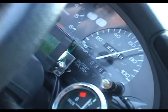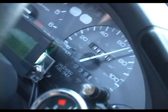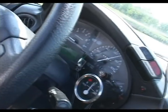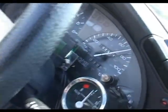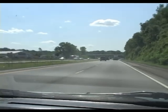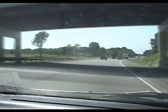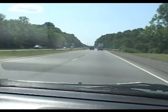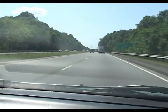See the gauge. I hit the pedal, you can see the 48 amps goes up to 180. And this car doesn't have any trouble keeping up with traffic. This is still just third gear. Because of high torque, you can use third gear even in the city. If you're in the city, use second gear if you want to be zippy. We'll turn around up here and you can see what third gear is like on a hill.